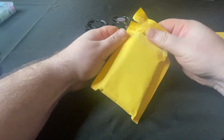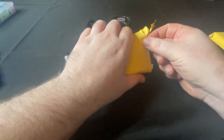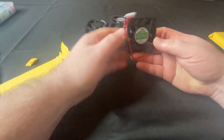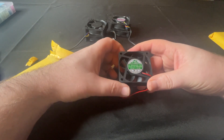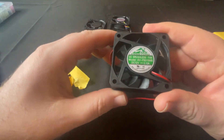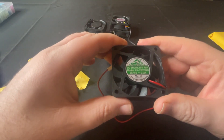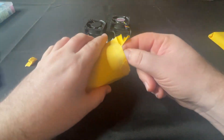They're not PWM. However, the support team at iPollo said these should be fine, and that if you're not going to run PWM, just go ahead and get a 4200 RPM fan. The factory ones are 5400 RPM, I believe. So this is a 4200 RPM fan. Here we can see 12 volt, but they're 0.1 amps — so 0.02 amps less than the factory ones.